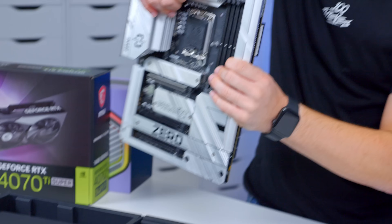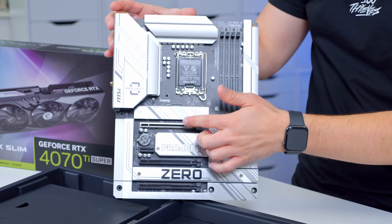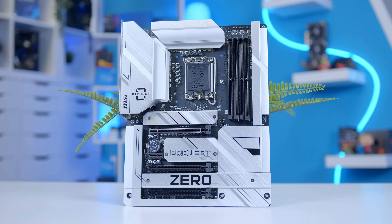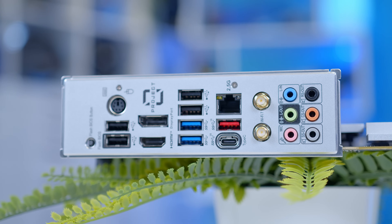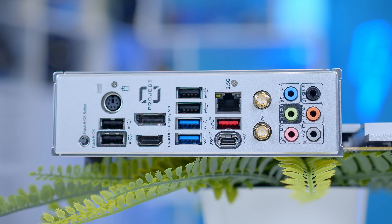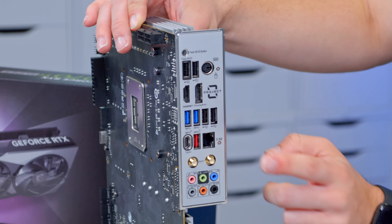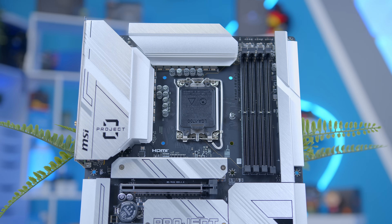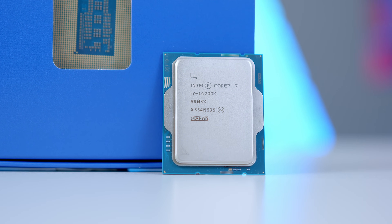I do acknowledge that this is the future and it's really clever. The only caveat is that you need a back-to-front or Project Zero compatible case for it to work. Z790 gives us overclocking for our CPU and memory, PCIe Gen 5 for graphics and the SSD, and you get loads of really nice silver shrouding all around the board that looks premium. IO is pretty solid too — loads of USB ports, a 20 Gbps Type-C, 10 Gbps Type-A, and 2.5 Gbps Ethernet with Wi-Fi 7. This board is 14th gen ready out of the box, meaning no BIOS update needed to run the 14700K.